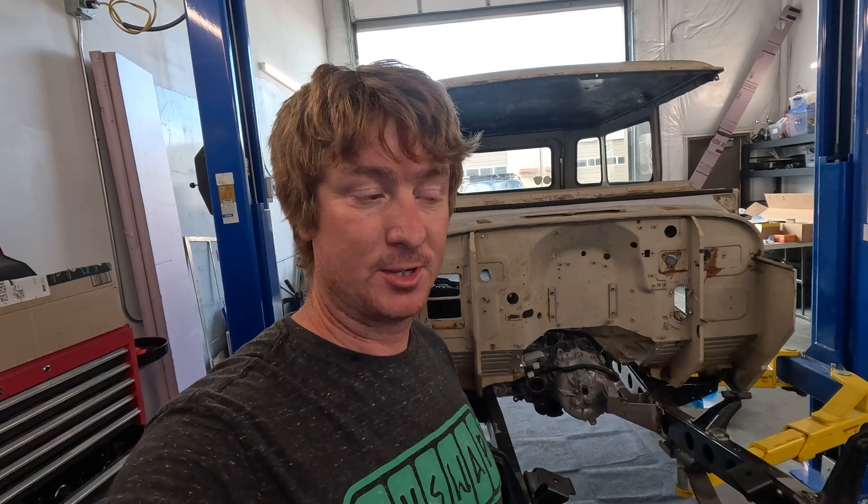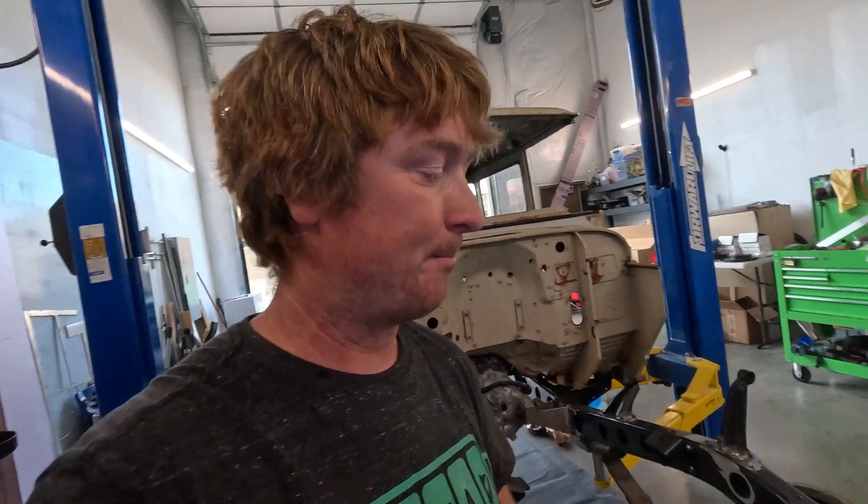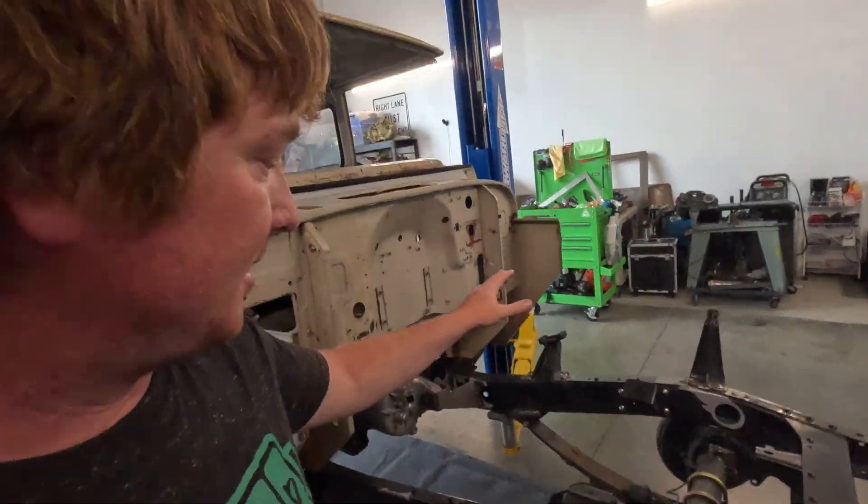I've got to figure out what battery I want to use. Am I going to use used modules out of a Tesla? Am I going to buy brand new batteries? I'm really not sure on this truck. Not only do I want 200 miles of range, but I want it to be very safe, so I'm even considering lithium iron phosphate batteries — though that would be expensive since I'd have to buy them new. I'm also considering Hyundai batteries. I had experience with Hyundai modules out of an Ioniq 5 on my Electrek build and was really impressed with the size for the capacity — good form factor, good mounting locations, and good bus bar adaptation. We're going to need at minimum 70 kilowatt-hours, but probably closer to 100 kilowatt-hours to really get 200 miles of range. Luckily we have all this space to fit as much battery as we need.